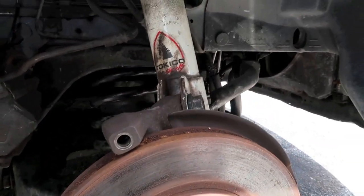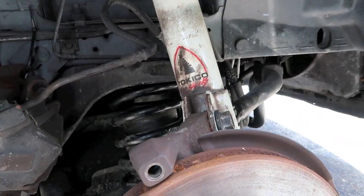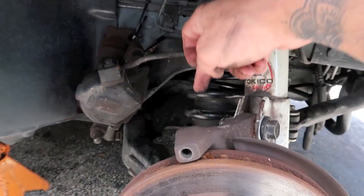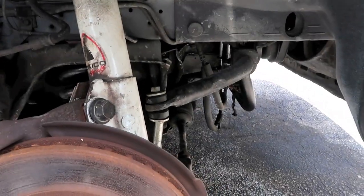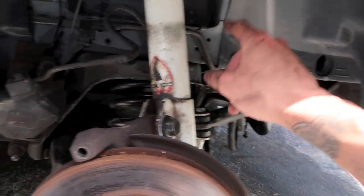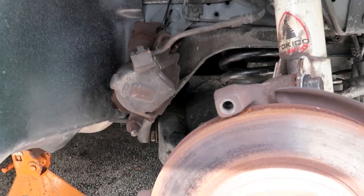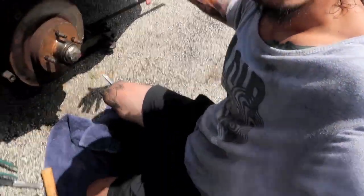Once it started giving me trouble I kind of turned off the camera and got upset while I was working on it, so I just wanted to get it done and forgot to turn the camera back on. But we got the spring back in, the bolts are in. We still have to put the nuts on the back of the bolts that hold the control arm to the shock, tighten up the sway bar, put the caliper back on and tighten that up. I can't even really tell by my voice but I am completely over it at this point - the sun is beating right on me, there's no shade, I'm super hot and just tired and I just want to finish this.